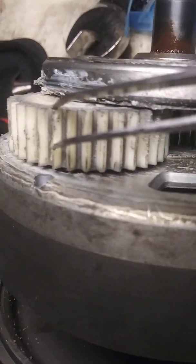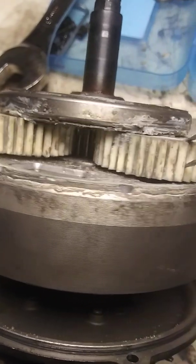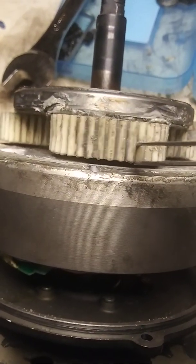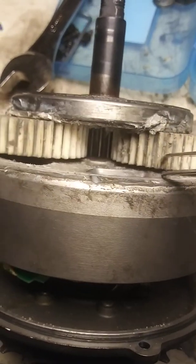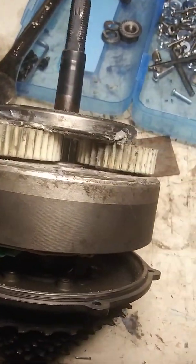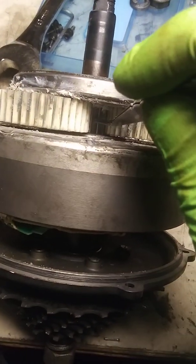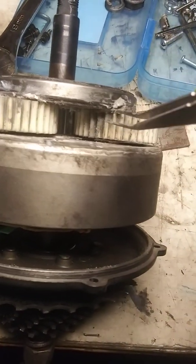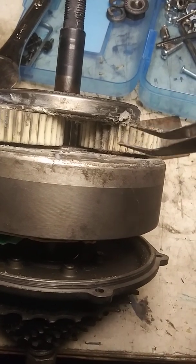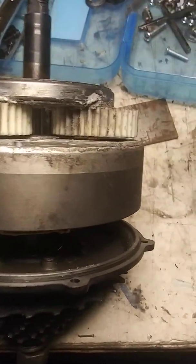Here's the section where the tooth had broken off and got lodged up in the center. Sorry, Bafang — not trying to take any business away from you, just trying to get the most use out of this motor. With this issue gone — which I would have thought catastrophic — it's actually a very simple fix: remove the bits and pieces of broken teeth from inside the planetary gear system that are creating friction and jumping during each revolution. That'll take away the rattling, knocking, bumping, and straining sounds you hear at higher speeds.